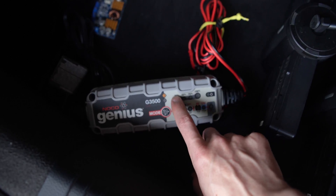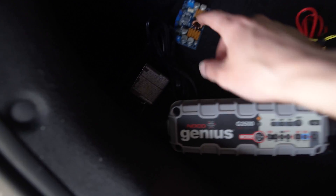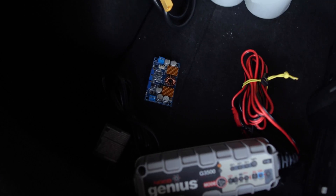I'll put the link for this below, as well as the battery and that video from Jorma Suman. He uses the LTC 3780 to convert the DC voltage straight, which is a little bit more efficient but takes a little bit more mucking around. Jorma's setup has no battery protection there at all, so there's no way to charge batteries without running your alternator at full tilt or risking killing your charging battery. This setup allows you to charge batteries anywhere, anytime without any direct impact on the vehicle.